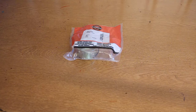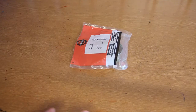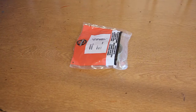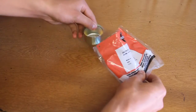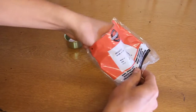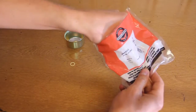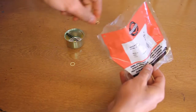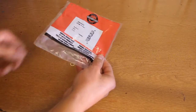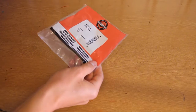So you can now go ahead and open up your new parts. One thing I do recommend when getting new parts though is you clear your work space completely so that you don't get new parts dirty and that you don't mix them up with the old ones. So in here you'll get a new float bowl, you'll get the gasket for the bolt, you'll get the gasket for the bowl and the new bolt for the bottom of the float bowl. I do sometimes keep my packaging for a few weeks just for reference in the future.